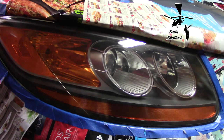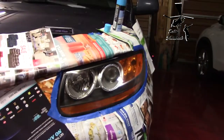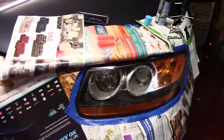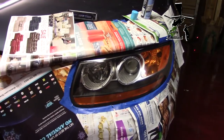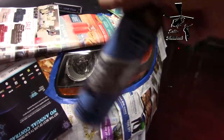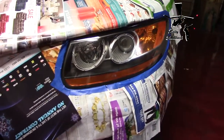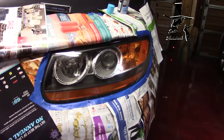Right before your eyes it cleared up. I am very happy with that. To restore your plastic headlamp covers, use Mother's polish with a little polishing compound — or some mild abrasive, maybe even a little baking soda with the Mother's polish — and then use some of this Meguiar's headlight coating. I'm gonna put another coating on, but it's not gonna look much different than this. There you go — hope that helps somebody.